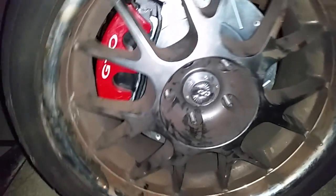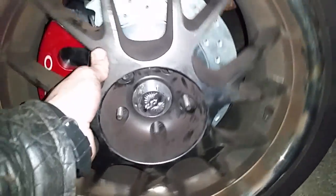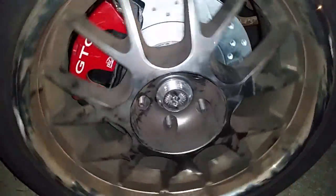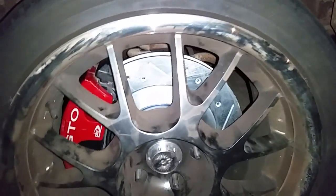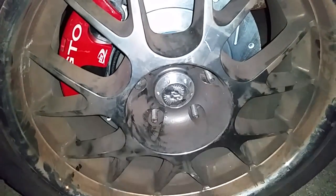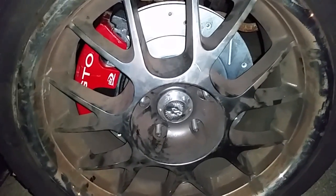For what I spent — which was $115 — I got a good deal and everything fit. They actually ask you which bolts you have, which is very important to me. Customer service is a big plus, especially when using GM components. Overall the quality of this particular setup is better than the one I got on my bird, because I was able to use the real 06 GTO calipers. The rotors are cheap, but I can get better rotors anywhere. I'm putting Timken bearings in it later this week and I've got Moroso made-in-America studs. The Classic Performance kit — all of it is imported, customer service is horrible. So it's up to you.